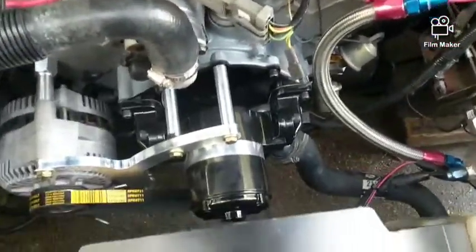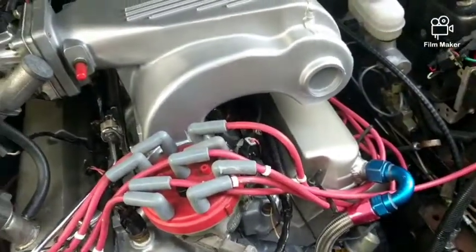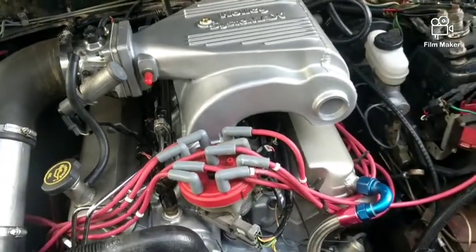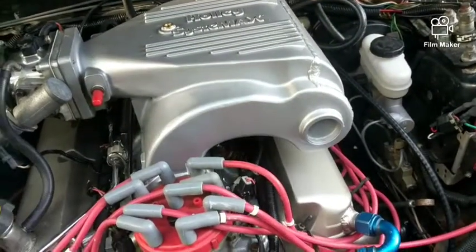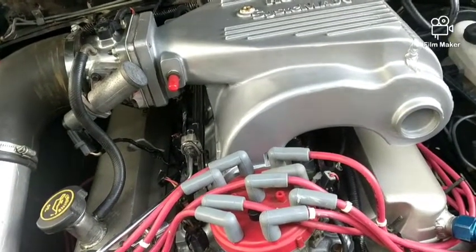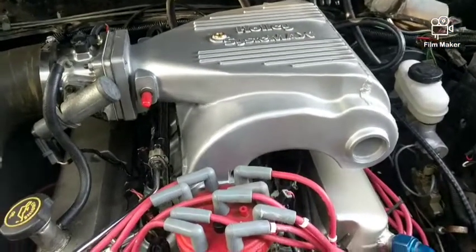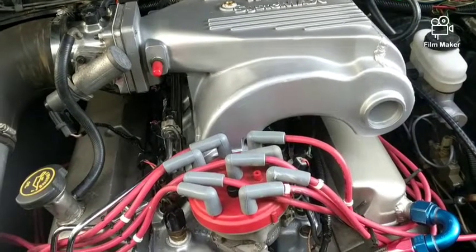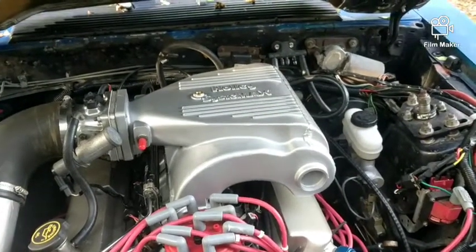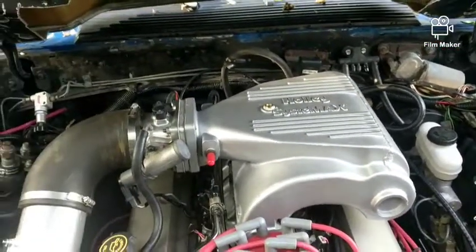It's finally on — I've got the electric water pump and the Holley on, still running the same 80mm throttle body. This upper and lower is what I had on the LTD before when I had the 302 in it; the lower's been port matched to the heads, and this upper has had about three and a half inches of runner length taken out because I was kind of a knucklehead — a computer program said I'd gain 15 or 20 horsepower at the top end, but I didn't pay attention to what it did in the mid-range. It's probably better to leave that in there, especially on cars like ours. Some guys in the Mustang classes will cut a little out, but they're also turning like 8,500 RPM.